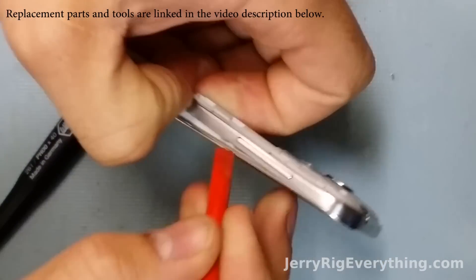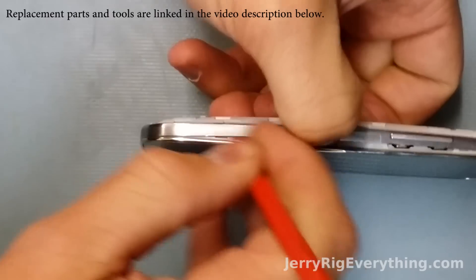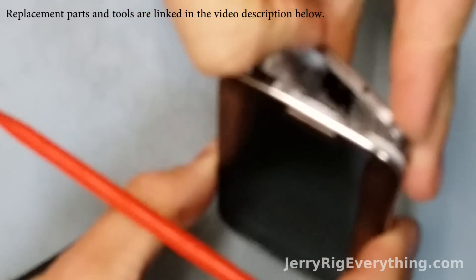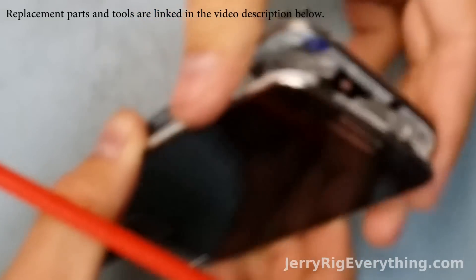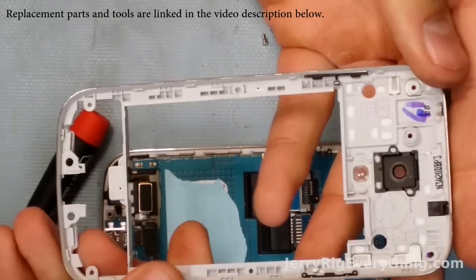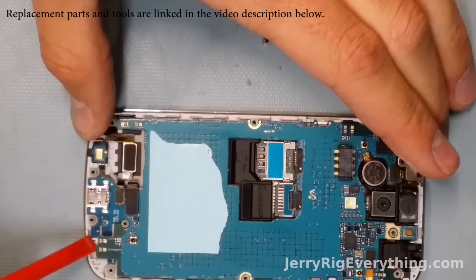So you take off the outer ring — the outer plastic of the phone. I found it's easier to put my finger in where the battery goes and kind of pull it away from the back of the screen. That gives just enough of a gap that I can put my pry tool in there and kind of swing it around the outside edge and un-pry it from the phone.